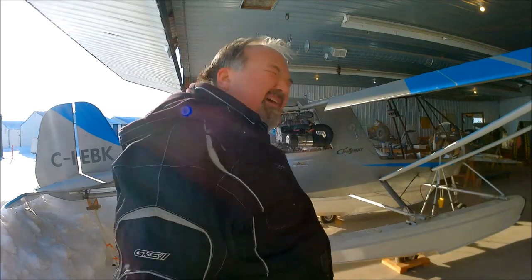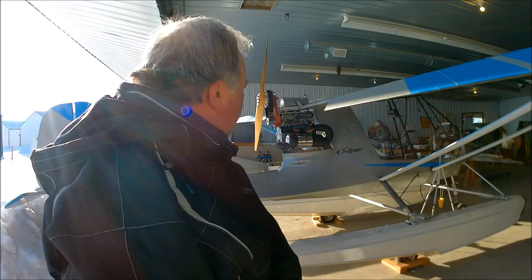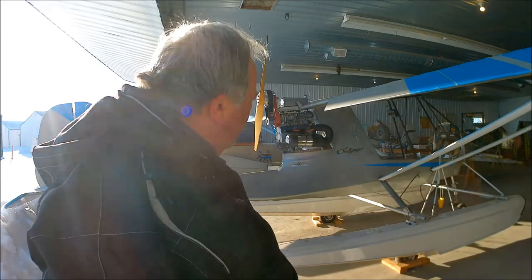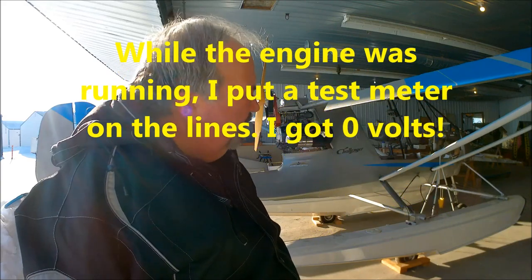I've got a problem. I cleared out the ports and it's still not drawing fogging oil, even at the lower RPM. But there's another problem — actually two. No charging current. One of my friends who goes by the handle 'the cotton patch' mentioned that my voltage was low, and I thought it was just a low-charge battery drawing it down. No. I'm not producing any voltage out of that charging circuit on that engine.